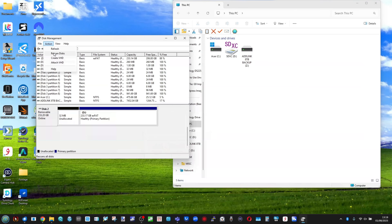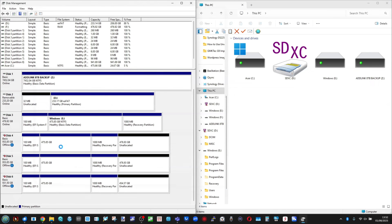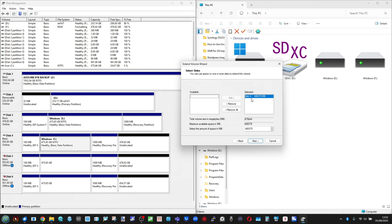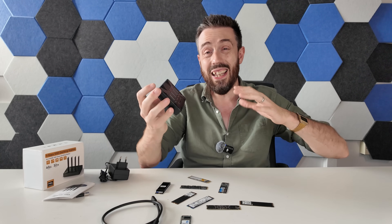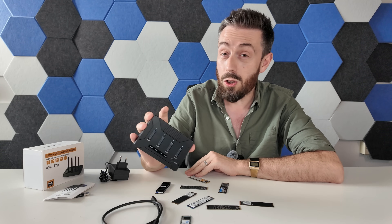A lot of users may be wondering about duplicating their OS drive onto a larger M.2. That is 100% supported - I was able to dupe a 500 gig drive onto three 1TB drives very conveniently. But do keep in mind, this does not allow you to extend or delete partitions. You'll still need to connect it to a client system to expand the existing volumes copied from source to target, which slightly reduces the offline nature of this for those looking to expand onto larger drives.